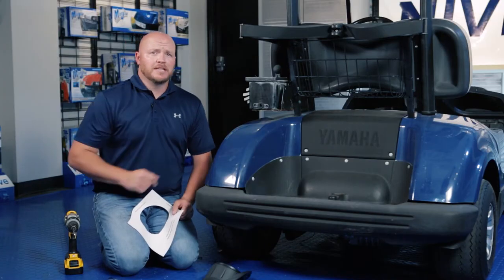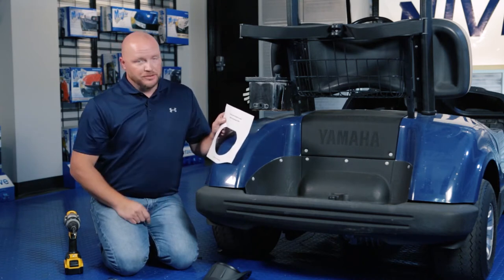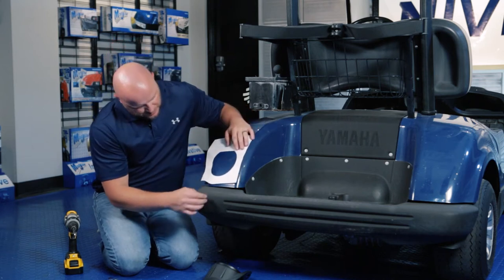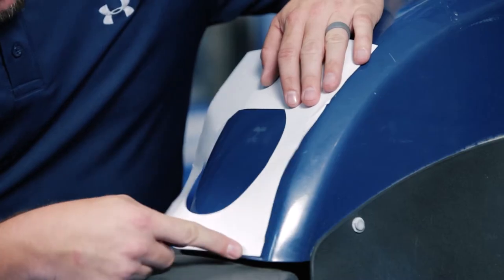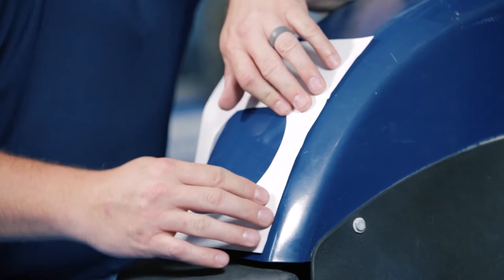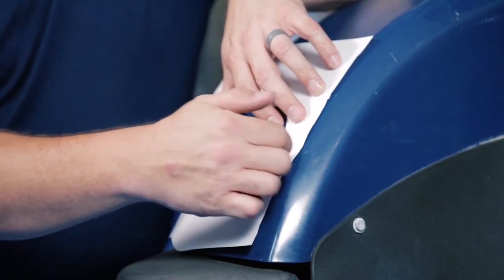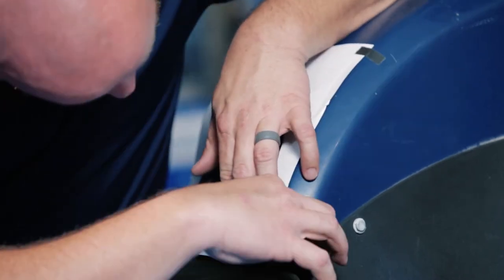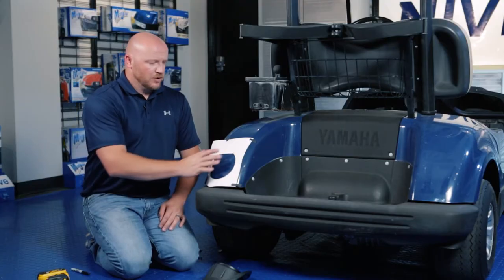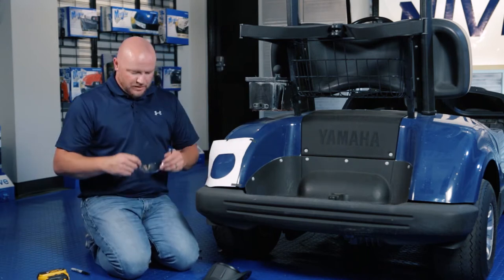Moving to the rear of the cart, we're going to cut out the template for our tail lights. With the supplied template, you'll notice that it says passenger side — we're going to flip this over for the driver side template. What you want to do here is follow the bottom side of the rear body and the curve. You're also going to want to come right here to the flat part of the rear body — not the curve, but right where it turns flat. We're going to tape off our template and then mark the inside. If you have factory tail lights, just hold the template up and see if you need to trim out any more. If not, you can skip this step and install your new tail light.